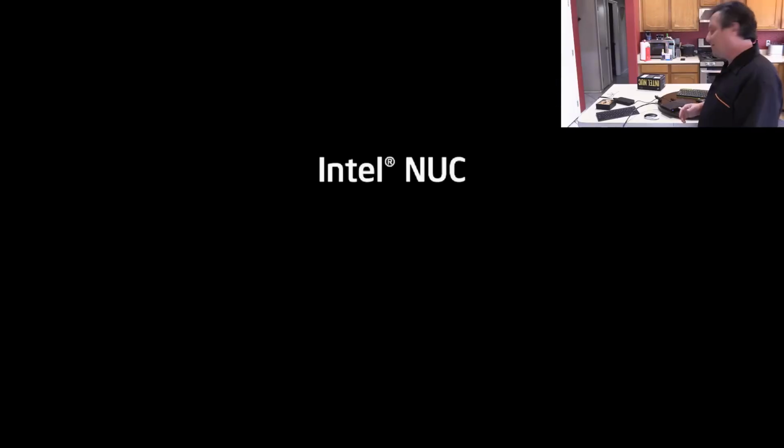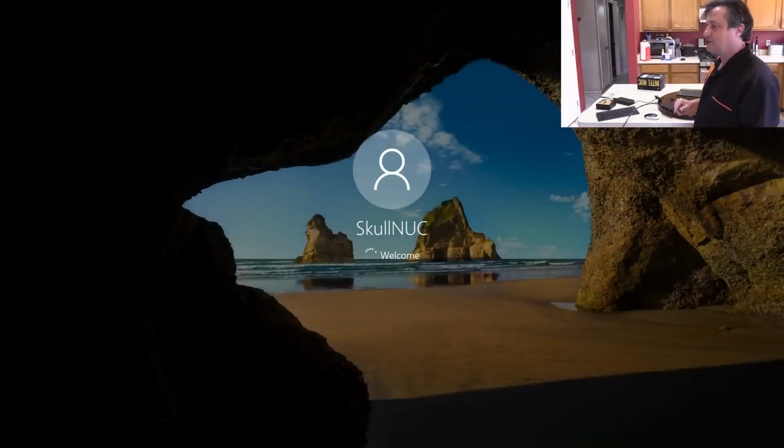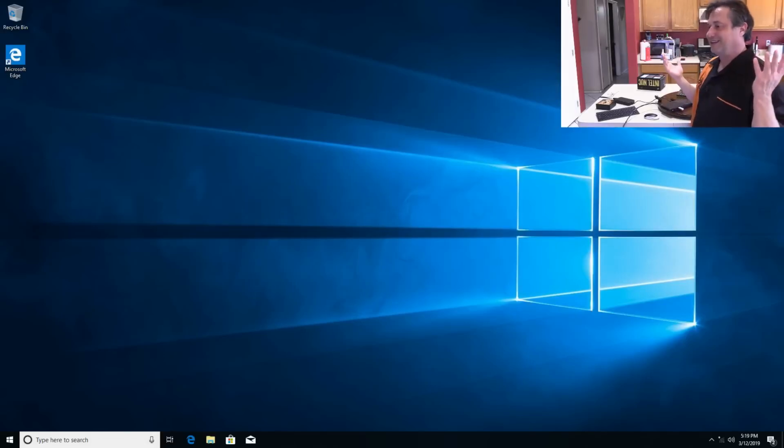If there's any system instability, which can happen with some memory and motherboards, just turn XMP back off. I've never seen a real difference with XMP on or off, except in benchmarking software, but I haven't really noticed it in real life. So let's see what happens if we boot up okay with XMP turned on. It's not even that much faster. We went from 2400 to 2667, so it's not like it's gonna be much of a difference. It's fractions of milliseconds at this point. There's your boot time, which, you know, hello.